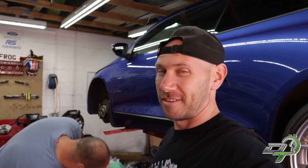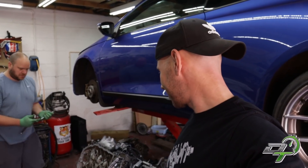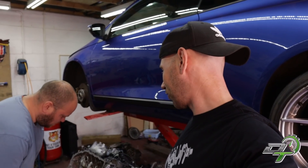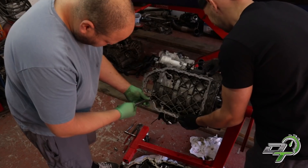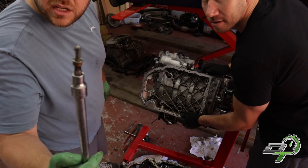I think this is going to be one of those ones where you start to dig in and you think, how the hell did this thing run? How did it even survive? Oil galleries are blocked, silicon's everywhere, pickup is full of bearing material and splodges of silicon all over. How much silicon are we going to find in here? There's loads on the end of that still.